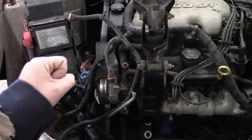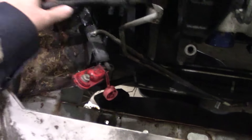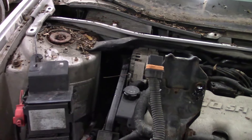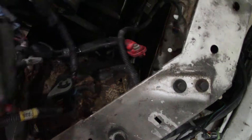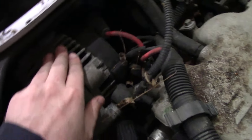If you accidentally trigger security while unplugging, it's easy because you can plug it back in and it recognizes it's working again. It's also why we don't pull the dash out of any cars — radio, cluster, all of that must stay. We will pull these wires in, get them in here. These were the two wires that plugged into the electric fans that we obviously removed. Then we have our fuse boxes right here on the strut tower — not a good place to leave them. I guarantee they'll break loose, shoot sideways into your pulleys, and pretty much shred themselves until the pulleys eat all of your fuses. That will shut a car down very quick. This seems like the most important thing to move — I've got it loose and it's hanging out right now.